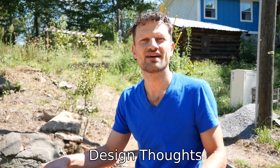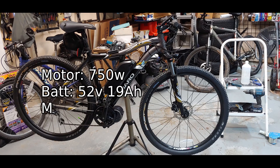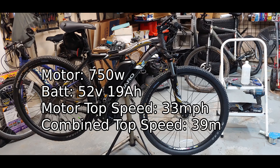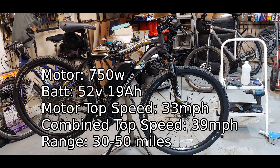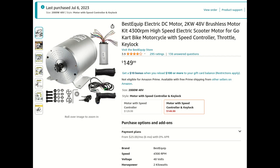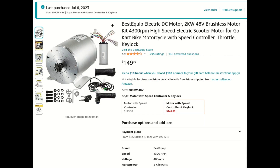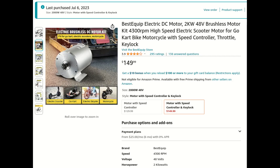I had a lot of fun building this ATV and now I want to tell you about the design choices that I had to make along the way. First, how much power does it need? I know that my e-bike can get me up just about any steep hill in the right gear, at least at moderate speed, but what about if I'm pulling an extra 200 pounds? To be safe, I decided to go with a 2 kilowatt setup because it was cheap and available. I'm not going to have a gear shift, so I need to get the gear ratio just right. Too low would be too slow and not very much fun. Too high would be too weak, and I might even burn out the motor under load. So I aimed at a top speed somewhere near 10 miles an hour.